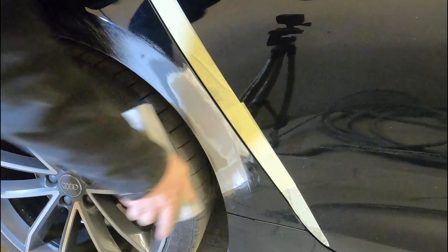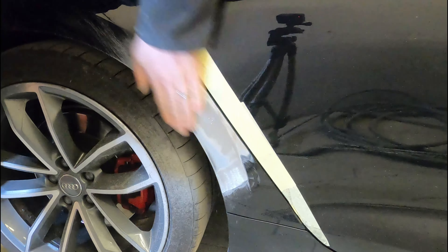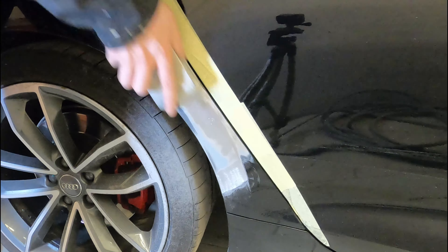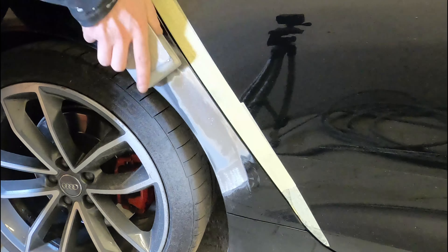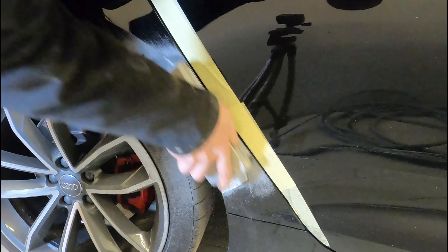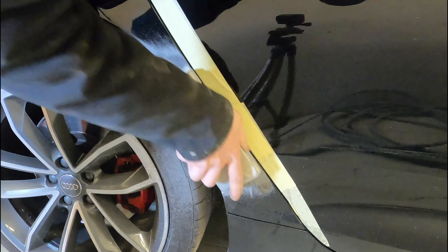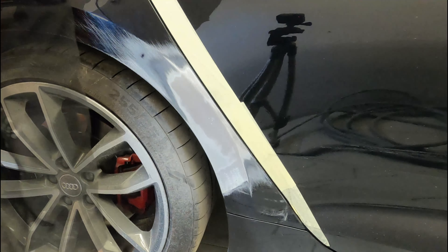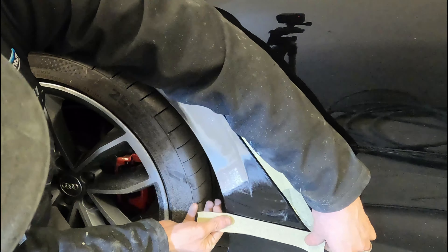The biggest part of this is we just want to give it a really thin, very fine skim — we don't want to put a load of filler into a brand new car. We want a nice light finishing filler that we can block out, leaving a very fine layer. We don't want any heavy thick fillers in there; we just want a nice light finishing filler so that when this job's done it's a nice seamless repair with very little filler or film build added to the car.